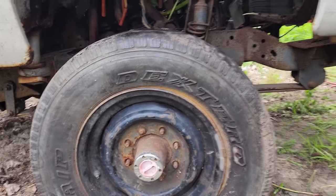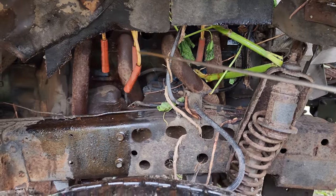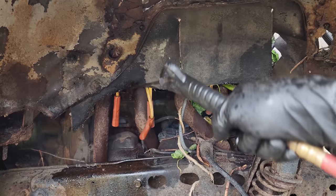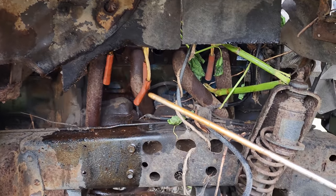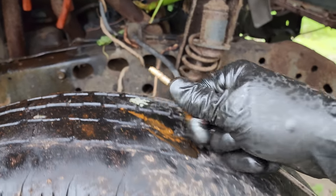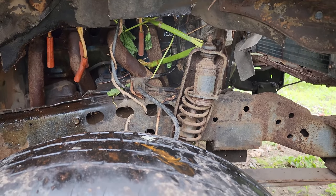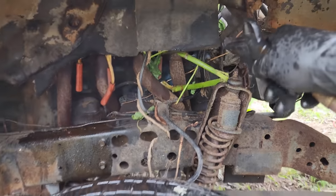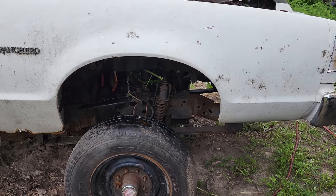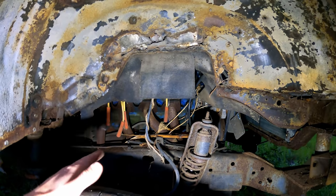Two days later, I'm back over here. Got underneath with the breaker bar again — engine's still locked up no matter how hard I crank it. I used the blow wand, blew into each cylinder and a lot of rusty, sandy nastiness is coming out. We probably should have borescoped these originally but I didn't have that with me the first day. I think it's safe to say at least a few of these cylinders are in really bad shape. I'm going to leave this here longer and we'll check back — see if any magic takes place. Going to shoot some more PB Blaster in there, give it a couple more days and see if that does anything.